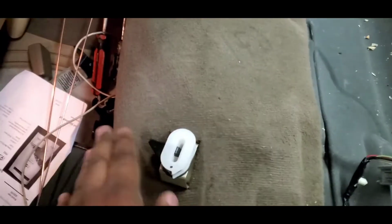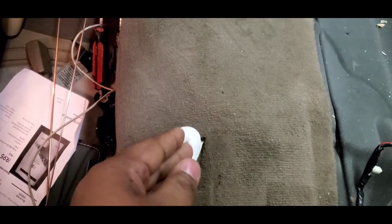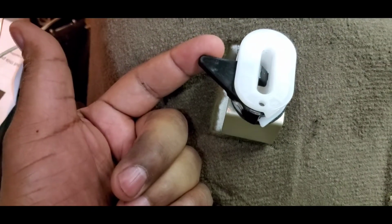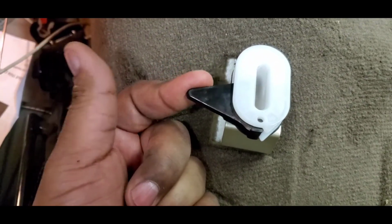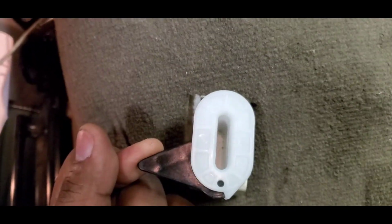Now, the construction of the rear lower seat: you have these 4 sections that the seat tucks into right here. So you got one at about this angle, about midway. You have a screw inlet there for it to latch onto, and then you have 2 more on the opposite side. Now, when getting up under here, understand you have to really dig in hard so that you can get to this lever, and you'll be able to feel it. And once you get that lever out, you pull it out that way so that you're able to release the clamp that's holding the seat in place.